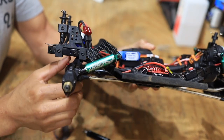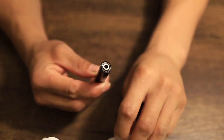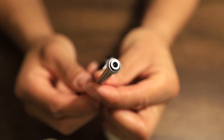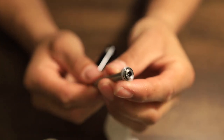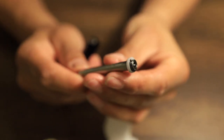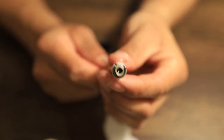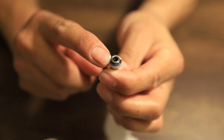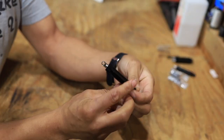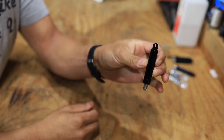There's really no resistance there, and that's 47.5 weight. Now one of the other downsides to the shock is the stanchion — it's hollow inside, and that was a big pain because when I was adding oil I would get nothing but air buildup in the stanchion. That was so difficult, and that was another reason I just had to let them sit overnight and let all the air circulate to the top, then put more oil in them. So they definitely took about three times as long. I'm actually thinking about mounting these guys upside down — let me know, do you run your shocks upside down or right side up?